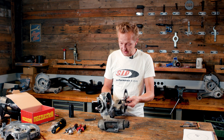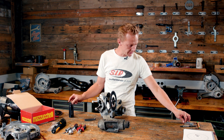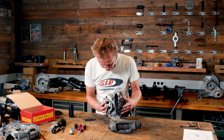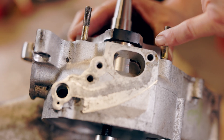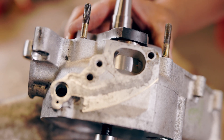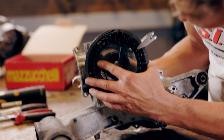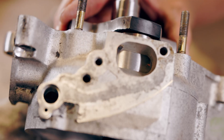And then we can apply the usual degree scale and also such arrow. What I need to do is to put the zero degree to the moment when the intake starts opening. The intake starts to open in this position — align that to zero degree. And now I'm looking at what happens here.